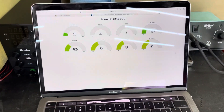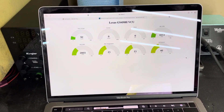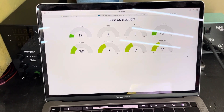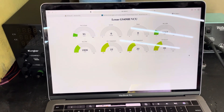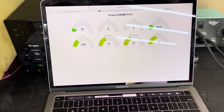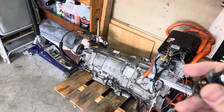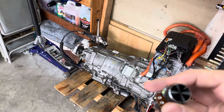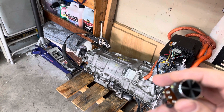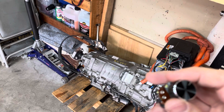Come over here on the screen — the motors are spinning at 1600 and 2800 RPM. We've got 92 volts on the pack. There's no current sensor attached so you won't see any current. The two motors are each 22 degrees C — they run up to 120, and you can push up to 150 if you want. I've got a little oil pump PWM signal, so let that go down and up. That was today's work.